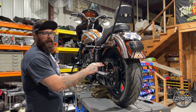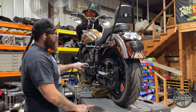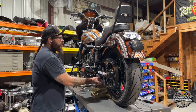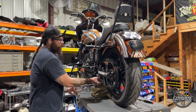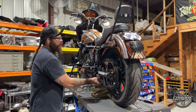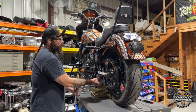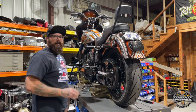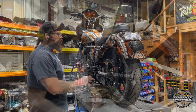Whenever it's at its tightest point, that's when everything is in line — you're trying to line up the rear axle, the pivot shaft, and the front pulley or sprocket depending on what you're running for a final drive. When you find that tightest point, it's going to start getting looser again. We're going to lower it back down, keep getting tighter, and right here is about our tightest point. That's where we're going to start setting our belt deflection.